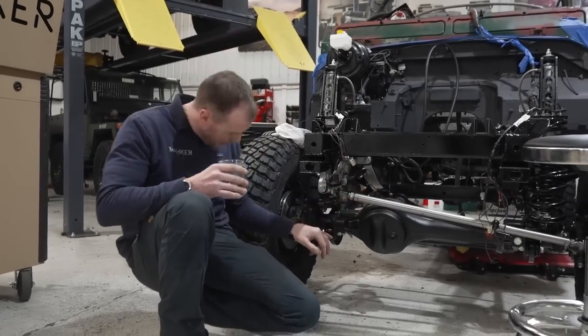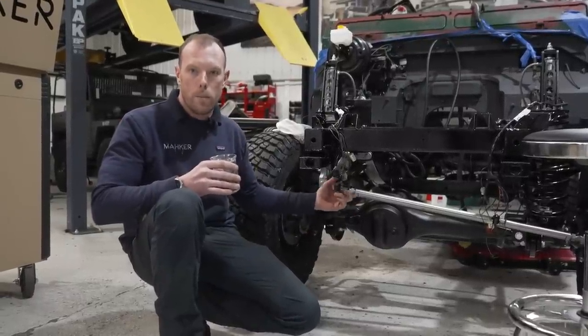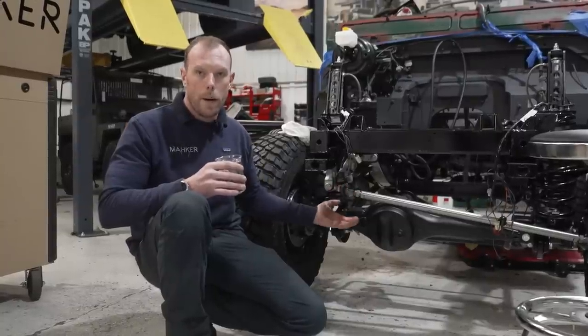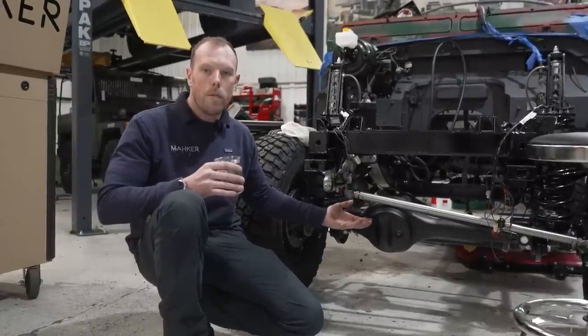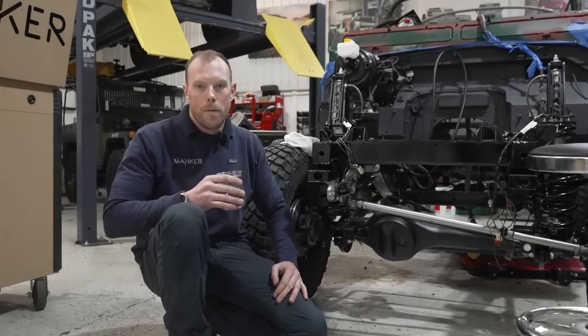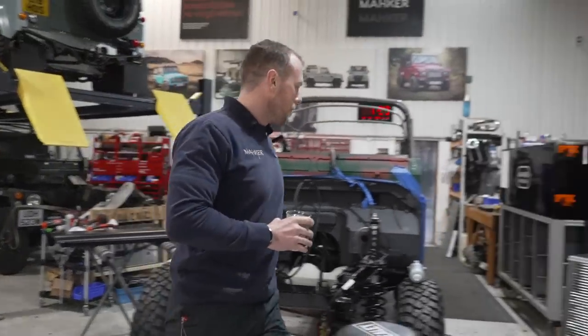So this is basically allowing us, if I have a ball joint failure, I haven't got to mess about trying to rebuild the ball joint. I literally pull one out, undo that bolt there, this locking nut, and I basically bolt another joint in. So something we can repair in the desert. So thanks again, Gwyn. I'm sure I'll be praising you, mate, when we've hit something out there and bust that off. Where else can we go?